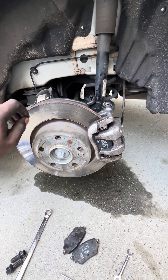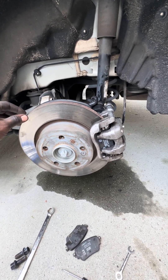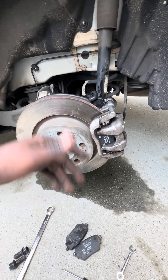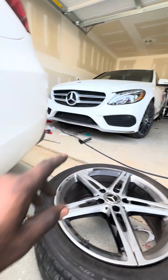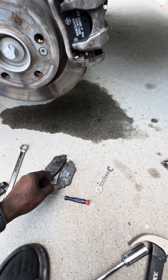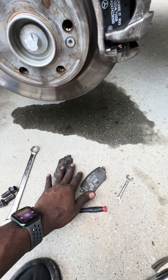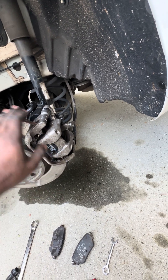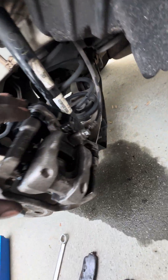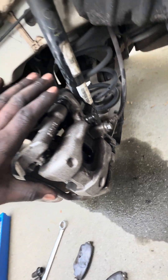I was trying to keep the video under three minutes and I did, but I didn't cover everything. So let's go do it. Step one: you've taken off everything, tires are out, you've got your new brake pads set up — new ones, old ones. You want to get the old ones out but you can't fit your new ones in because the caliper won't retract.